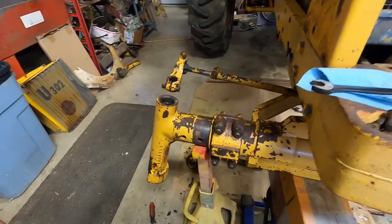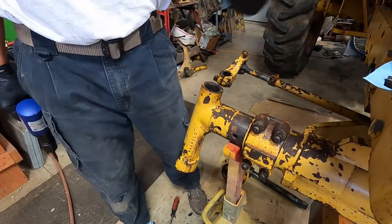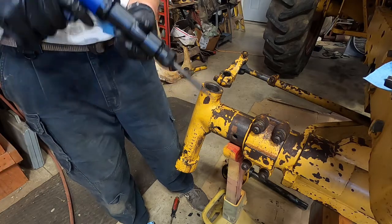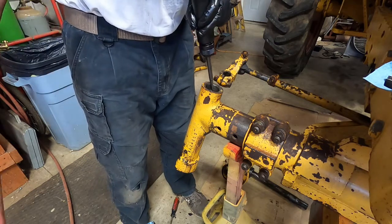This is a very greasy, dirty job. If you like grease and dirt, this is the job. I ran out of grease on the last side and reloading the grease gun is one of my least favorite things to do. On my air hammer I have a pointed tip. I'm just going to try to get it in there on that edge of that bushing, get it started underneath it, and then bring it out so I can get a hold of it.